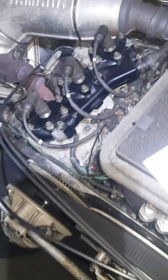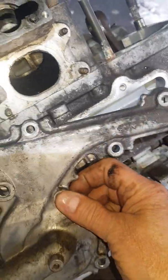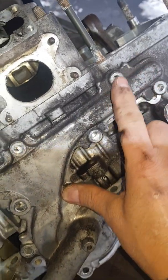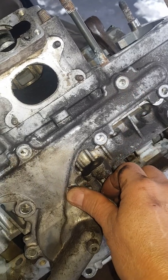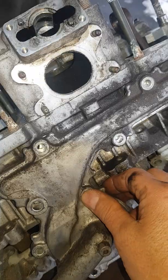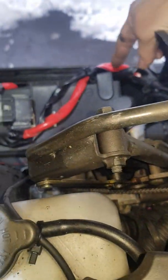There is a screw — let me show you. This is the water pump, this is on the exhaust side. This bolt right here — they say to take this bolt out and let the coolant drain underneath into the pan there, but it's all just going to go underneath the snowmobile anyways. Also disconnect the negative terminal on the battery just in case.